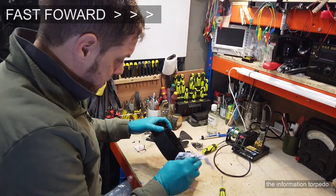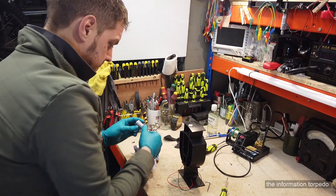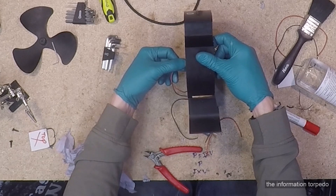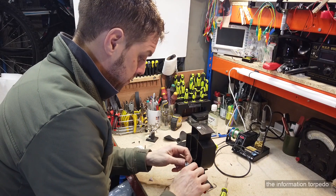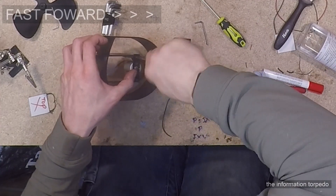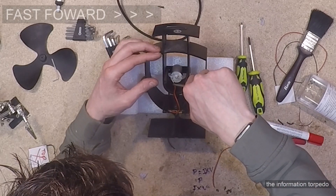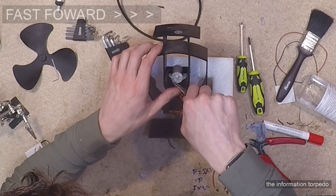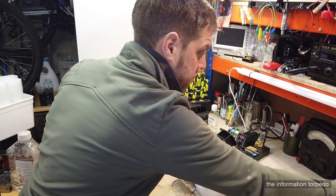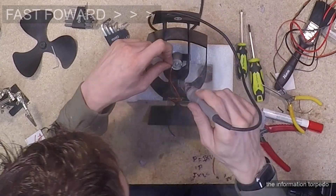Now we've got the peltier back in, we need to put the motor back in and solder it. I place the motor in, measure the cable, and keep it as short as I can without it touching the steel. Expose a little bit of cable and twist the strands together. I put the fan back in at this stage too. Pushing the cables through the holes or wrapping around the posts, tidy all the strands up and make sure nothing's touching the case, then apply solder — get everything hot first and place the solder on top.